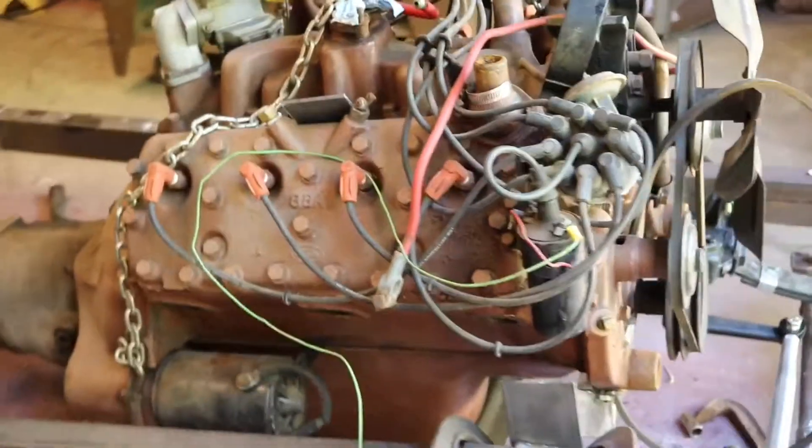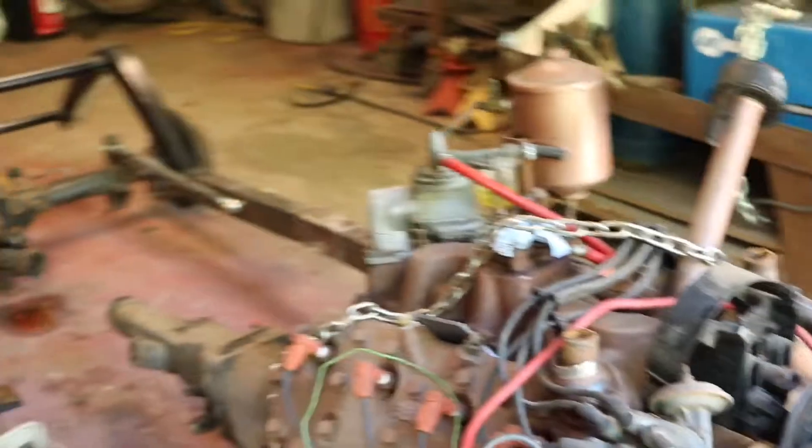So I've got to do it to the other end the same way and we'll have that done. I had to weld and build this piece right here for the drag link that comes from over there to here, and this is the tie rod — that's where the tie rod hole is. And I had to build that and weld it on. The tie rods came out of a '56 Ford pickup truck — this is all '56 Ford here. We cut it down, narrowed it, put it in, and I still got to clean it up some, but we just put the motor mount in just a minute ago.